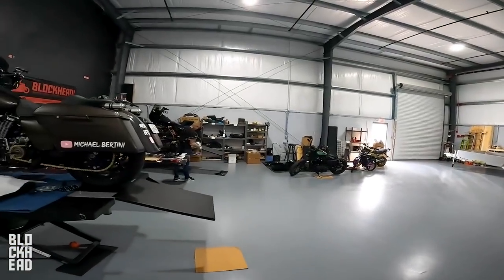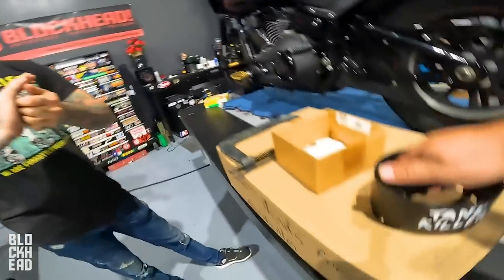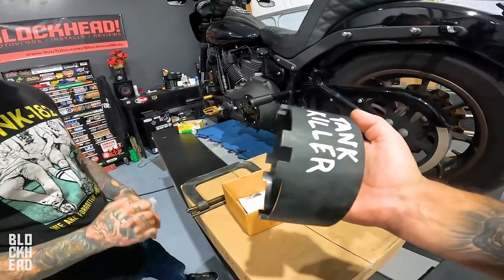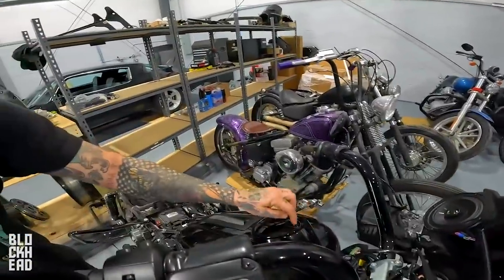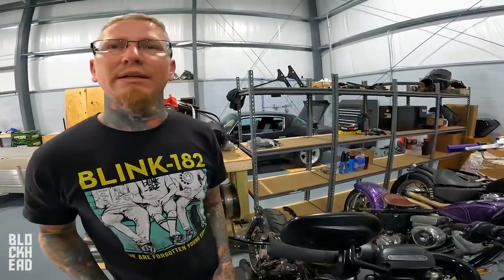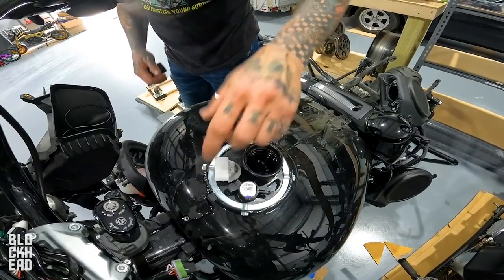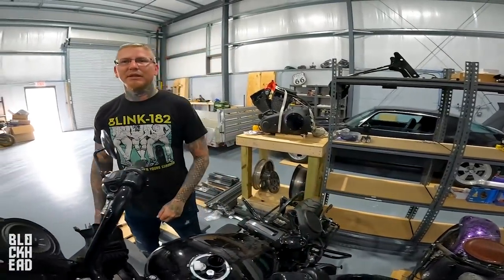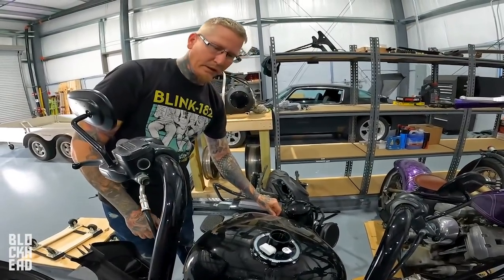Welcome back — next day in the shop, rainy day. We received a shipment. We got the tank killer. Why do they call it that? Because it weighs about six pounds, it's sharp with nice teeth, and when it slips off — I've seen guys do it — it lands on the top of the tank. Under here there's a big ring that holds the fuel pump in, and this aligns with the flats on the ring. The ring is under pressure so it actually compresses to pop out. What happens when guys loosen it and it pops? The tool goes down the side and scratches the tank — hence the name. But we don't do that here. I have not done it in my career — knock on wood.